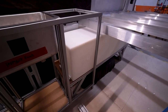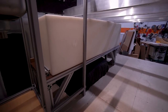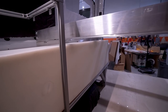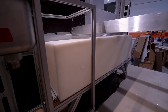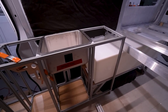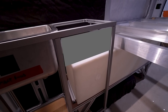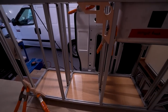This is a game of Tetris. Our 50-gallon water tank is on a bridge over the wheel well — we couldn't have made better use of that space. Those wheel wells have rattle trap, heavy mass vinyl, and then Thinsulate. We leave just enough space for our C channels for hatches, sensors, anything that goes in the top of that tank. The top of the tank intrudes into the galley slightly. The owners wanted their sink in the center of the galley with prep space on either side. We'll give them a nice little drawer above the water tank, a cupboard below the sink, and a drawer box.